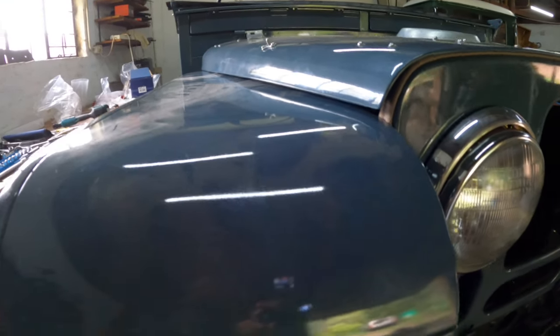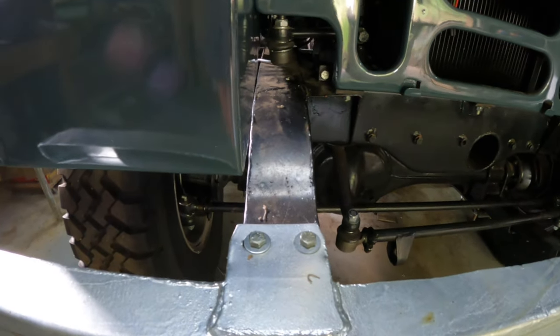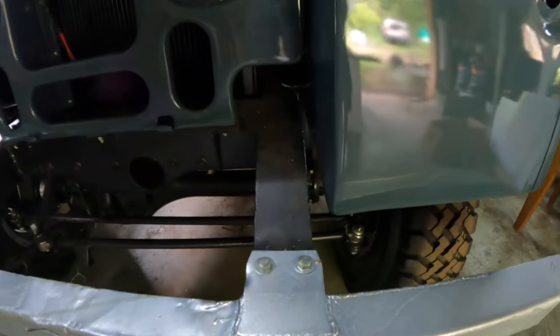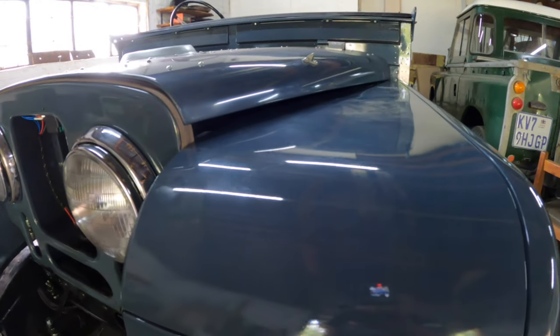In the end, I had the wings fitted, but the fit of the right and left wings didn't look right. The left wing was far off and the gap to the bonnet seemed a little bit much. On closer inspection, the radiator panel was not properly centered and was sitting a little bit too far to the right, which is why the bonnet wasn't actually centered properly.